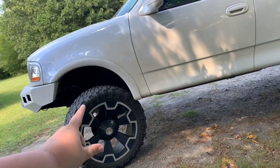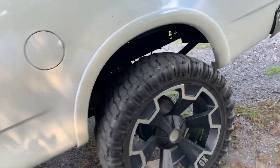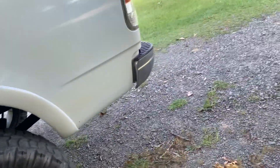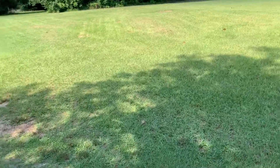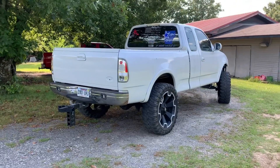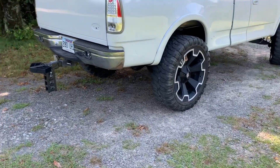This leads me to the next point: tires like these — aggressive tires — when they sit, you develop cold spots or flat spots in the actual tire. That will cause an extreme amount of imbalance and it's going to shake and vibrate and you're going to think your truck's falling apart, but in all reality it's just cold spots or flat spots on the tires.